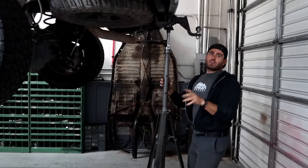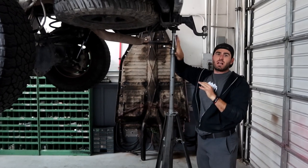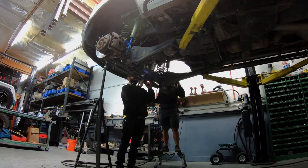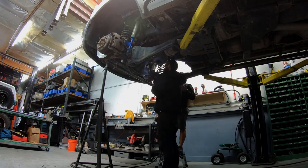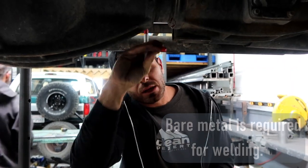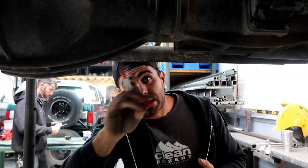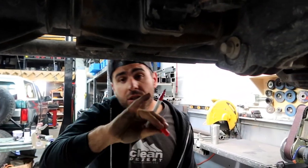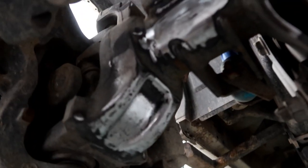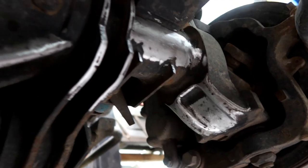The truck is up on the lift — it's pretty stable, but you always want to add the stabilizer on the back and on the front of the truck for extra safety. What we're doing now is marking with a pen all the areas we have to clean up and bring down to bare metal where the brackets will attach the truss. We got some here, obviously the ends, and there are little gussets to go in all over the axle. We got everything cleaned up with the barrel sanders and grinders — everything's nice and clean now.